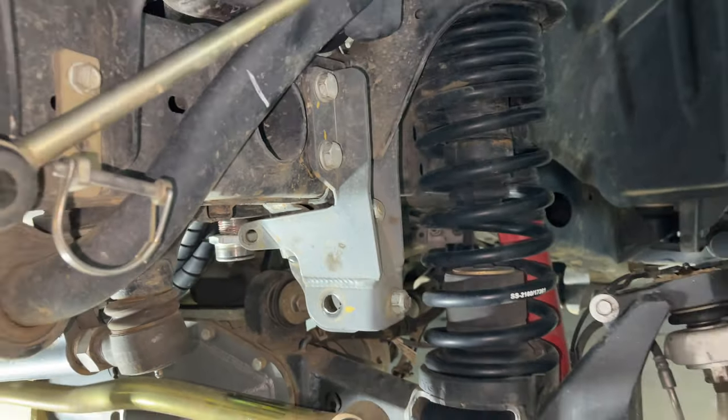What we're going to be replacing is my track bar and sector shaft brace. I currently have one from Synergy — I've installed a couple on the channel — it's been okay, but I am getting noise from the front end on the driver's side, kind of right from that brace. I've changed a few things out: replaced joints in the control arms, tie rod ends, went with the Grim hardware kit with shoulder bolts, done ball joints, and also done a hub on that side. None of that has fixed anything, and every time I take that brace off and put it back on it fixes the noise for about half a day, so I think it is the brace.